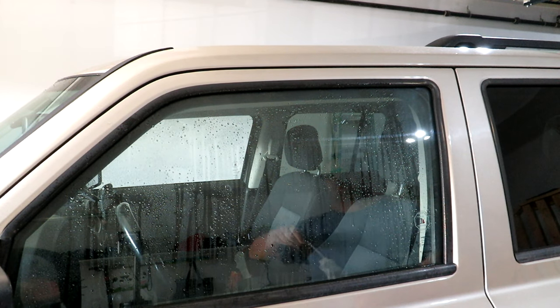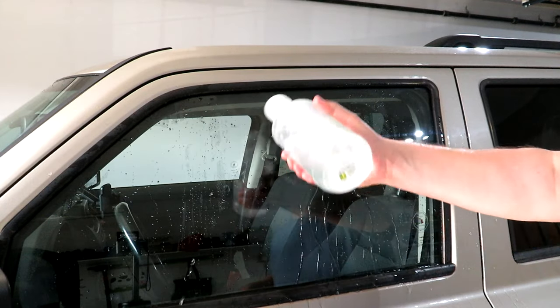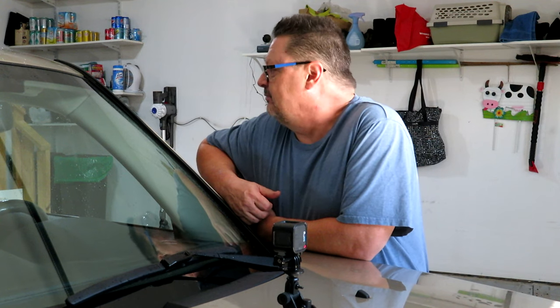When I splash large volumes of water on it, it just clears itself off. Rolling down the road at 80 kilometers per hour or about 50 miles per hour, that water just beads right off the windows. Okay, that's it for this video — we changed the wiper blades on a Jeep Patriot, and applied Rain-X over all of the windows to help the water bead off quickly. It helps the wiper blades last longer because they'll just glide across the surface with no drag, and it'll help with visibility in rain, sleet, and slush. Depending on your conditions, the Rain-X should last three to six months.